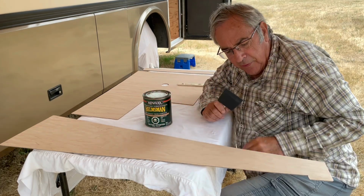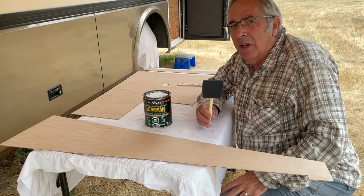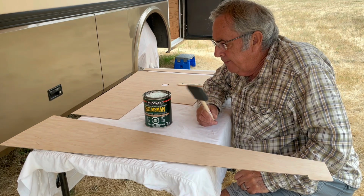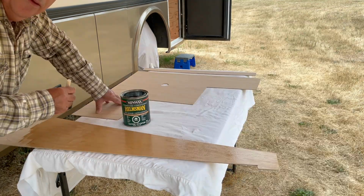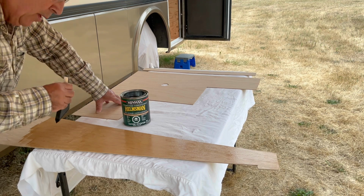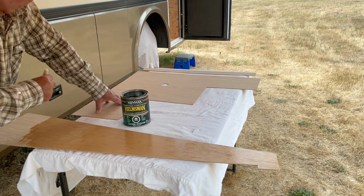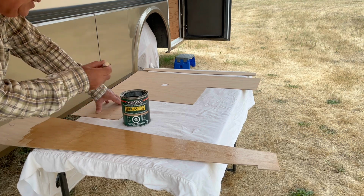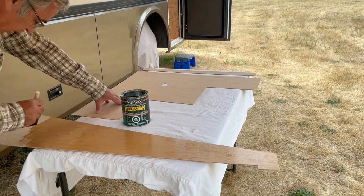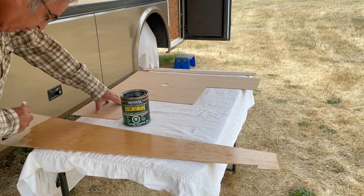You don't have to be very fussy with the first one. I just use a foam brush. You know, this is not a piece of jewelry. So let's just get at it. You can see how this urethane is really raising the color just with one coating. Remember, you're just laying the urethane on the surface. You're not brushing it in. You get bubbles that way, and so you just want to always maintain a wet edge and keep lots of it on your brush.